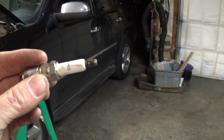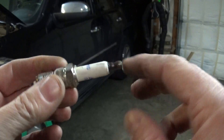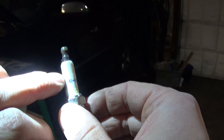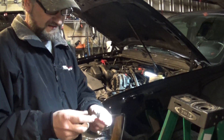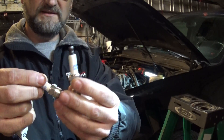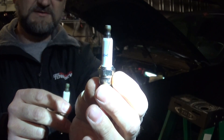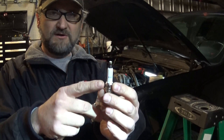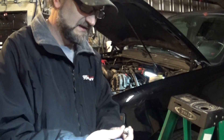There we go — it is a broken porcelain. Most likely what happened is they dropped the spark plug during installation. You can see it's a brand new spark plug, but they must have dropped it and broke the porcelain. We can see the cracks here and here. We'll get a new spark plug and fix this. With that MT 2400 tool, when you see the spark KV going up, it's always outside the combustion chamber — and this is exactly where the voltage leak was.